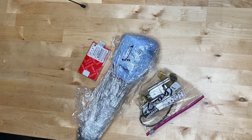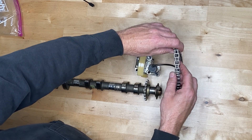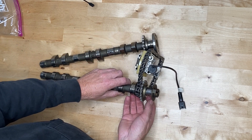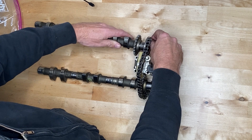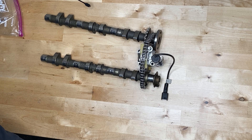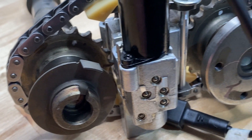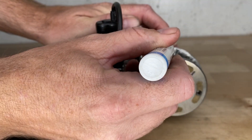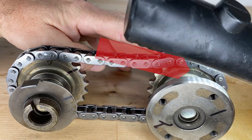The advice I got from Lee Jenkins is pivotal to even being able to contemplate pulling this off. Starting with the VarioCam: those little plastic pads we discussed in episode 20, the VarioCam extravaganza — we bought those plastic pads and the chain in episode 24 from Pelican Parts. It's a pretty tight fit but we got it in. On bank one, that notch on the intake cam is at the top, and then we need to count across eight links on that chain and make sure those little dots on the cams line up with the dots we made on the chain.